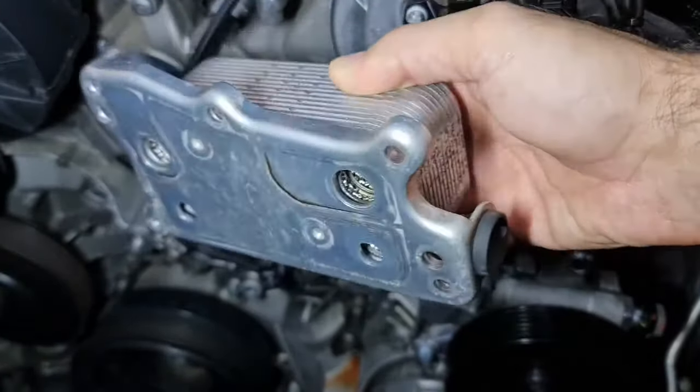All we need to do is lube it up and put it in there. Also, I have a complete video about this reservoir. As you know, there is a filter inside that you cannot replace, so the best method is to go ahead and replace the whole thing. That makes it leak-proof and makes your power steering functional without dirt and hopefully no expensive repair in the future. This is a kind of maintenance you need to do every 100K. You see that little mesh filter in there? That gets clogged.